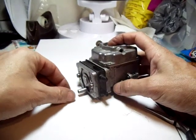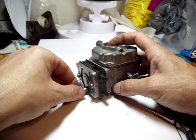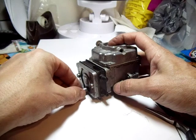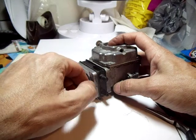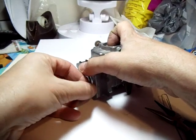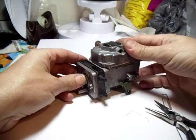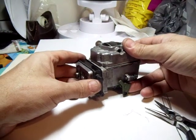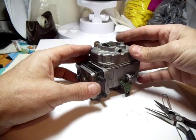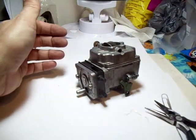That solves a lot of problems. The vacuum makes sure there's not a leak from the engine to the hose, because what happens is the engine creates a little vibration, a little suction vacuum, and it vibrates the diaphragm in there, and the diaphragm then pulls the fuel from the intake to fill the carburetor. The carburetor fills up — it's going to pump, pump, pump, unless of course the carburetor shuts off the flow using the needle valve. But that's a whole other video. Good luck.